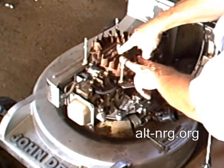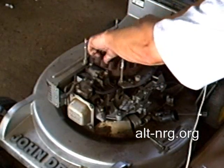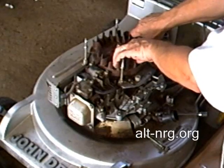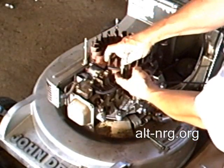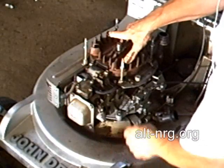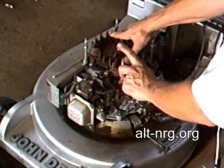This key exactly represents top dead center piston movement. So on one rotation it is on its compression stroke, and that obviously was the compression stroke. And at this rotation, this is at the top of the exhaust stroke and the beginning of the intake stroke. Notice that for every rotation of the flywheel, this magnet assembly moves past the magneto coil pickup assembly. And when it gets right here, it initiates a spark to the spark plug. So this engine generates 2 sparks for every 1 power stroke.